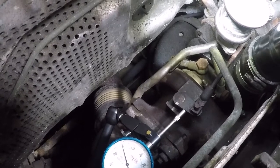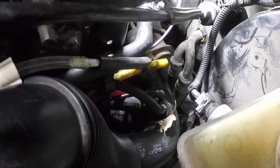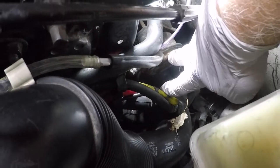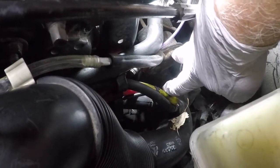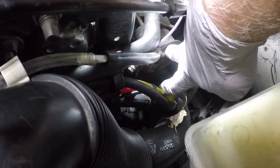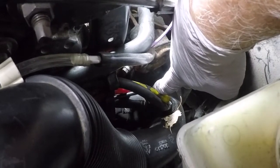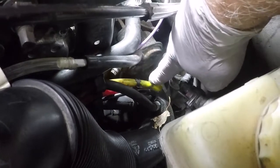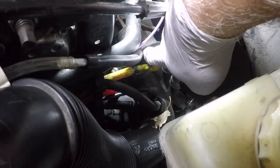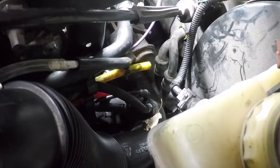I'm going to take it out for a road trip and we'll find out. Quick note just to explain — this right here is the turbo wastegate actuator. This is what pushes open. It's not a vacuum — it sits under vacuum some of the time, but it's meant to push that linkage open to crack that wastegate open. All I've done is take off the factory line and put in that line coming off the little radiator pressure tester. So there's not a complex setup to get that on.